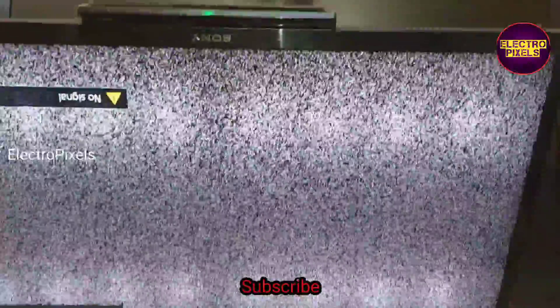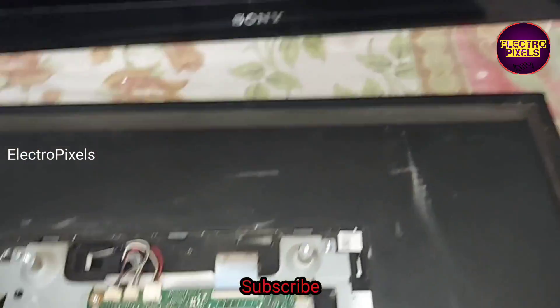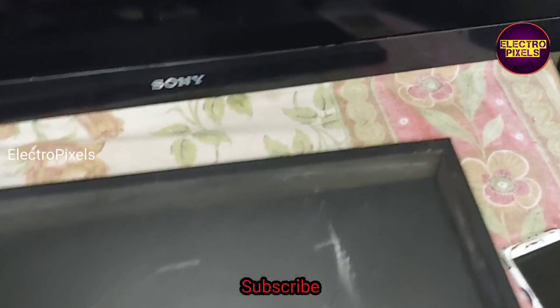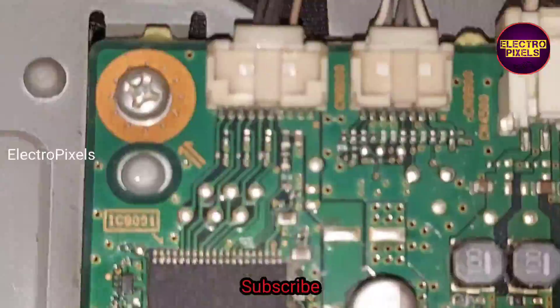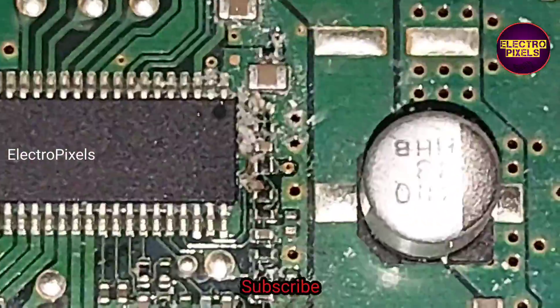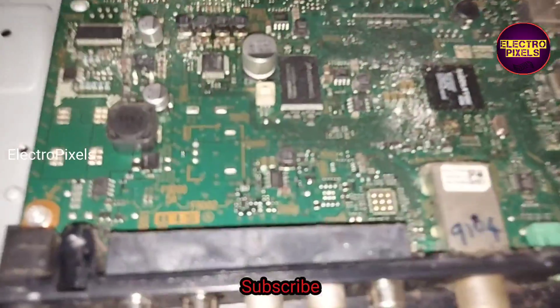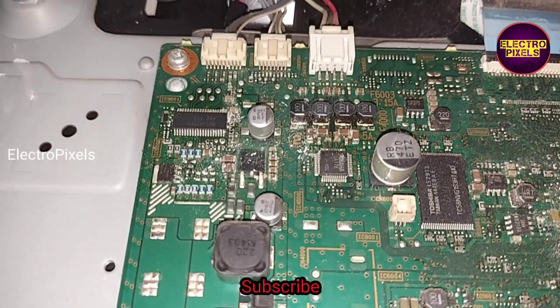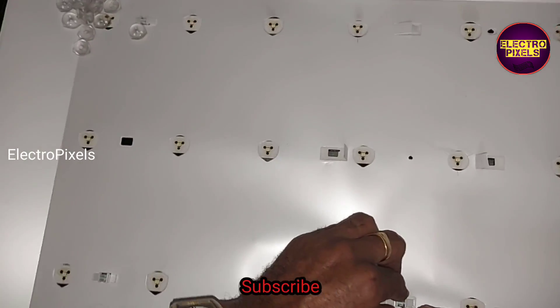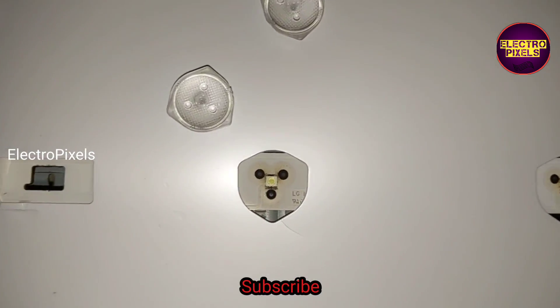In this situation, we need to replace the entire LED strip with a new one. Also on the top and bottom portion, the reflectors have fallen down, causing white light spots on the TV screen. In the middle portion there is a dark shade, confirming one LED strip is not working. We need to replace all backlights. Now I turn off the TV and here you can see the second pin of the inverter IC — the fail pin — that we cut down for removing the backlight protection. Finally, we open the panel frame and you can see all the reflectors have fallen down.